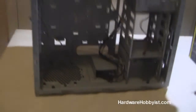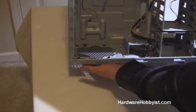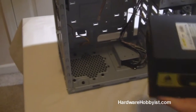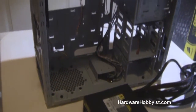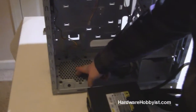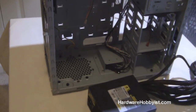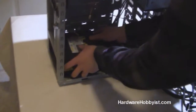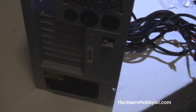Now Max is going to install the power supply. In this case it's bottom mounted, but it could be different in your case. Notice how this case actually has little feet and there's a little vent at the bottom — that's to allow a fan-down mount. So you can mount your PSU fan down to draw cool air from the bottom and then expel it out the back. However, if you are planning on having your case stand on shaggy carpet or that kind of surface, that's typically not good — especially not good if you're having a fan-down mount on the power supply, because the carpet's just going to block airflow and the feet aren't going to do anything. You're going to have no airflow and this thing can overheat really easily. So just make sure it's on a flat surface or you have the fan upwards. A lot of cases will also come with dust filters — for this case there are dust filters for the front panel, so that's always nice.